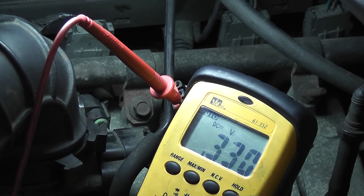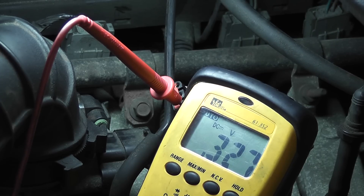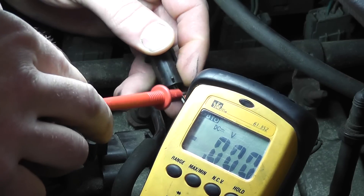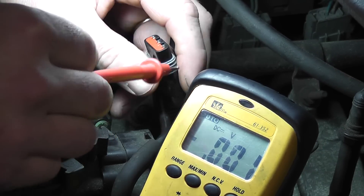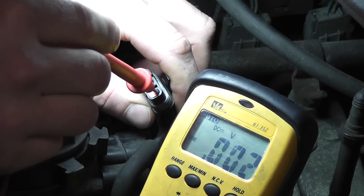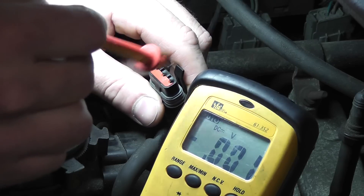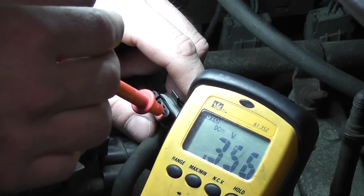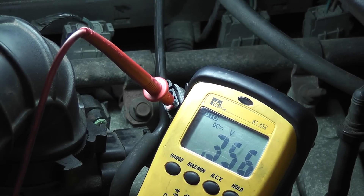Now that we've identified the 4 sensors that share the 5-volt reference, we're back at the TPS measuring the 5-volt reference wire. Looking at our wiring diagram, it was in fact a white with a black wire — and you can see that wire right there is white and black. This isn't a larger diameter than the female connector here, so I don't have to worry about spreading the pins apart. I'm just resting my multimeter lead in that pin and I'm reading 0.356 — obviously we should be at 5 volts.